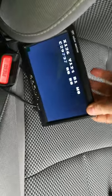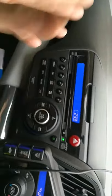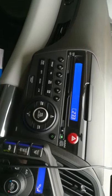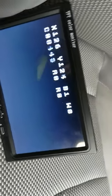I've got my laptop down there which I've just been programming the software with. The other thing is the screen - this is just a shoehorned generic 12-volt RCA composite video screen. A lot of people will have a screen in these cars with an RCA input, and you just plug in the phono to the back and then you get what you can see there.